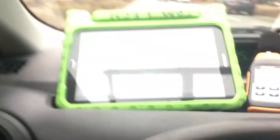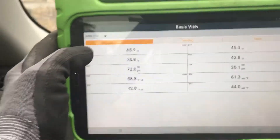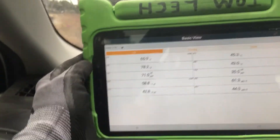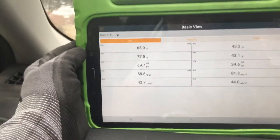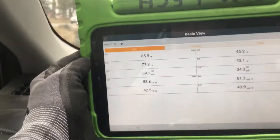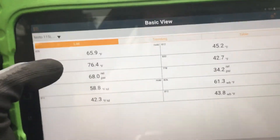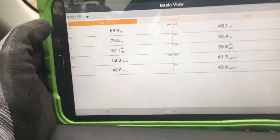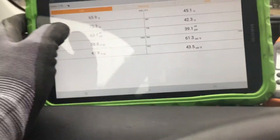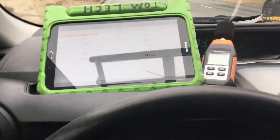So that's it for today. Normal refrigerant pressures with bubbles in the sight glass — lots and lots of bubbles in the sight glass on a completely 100% full system, where one or two days ago I just put 420 grams, which is the factory fill. And that is normal. These are normal pressures and these are normal temperatures. Catch you guys later, see you on the next video.